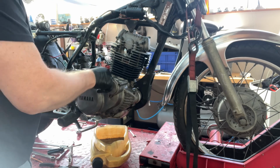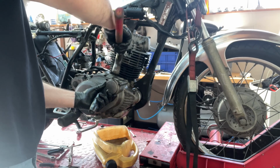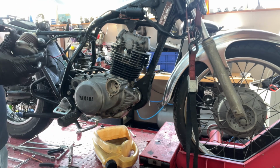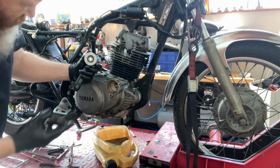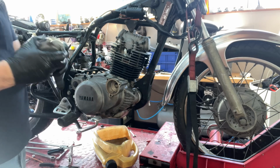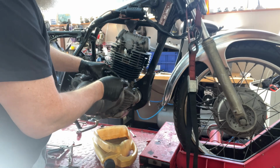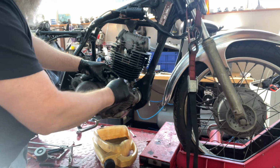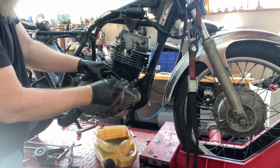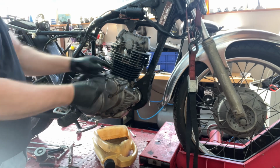Now, normally when you do a service on these things, there's a little 10mm screw on top of that little oil filter cap. You undo that, and the oil drains out as much as it can, and then you crack this off and not very much comes out of it. But in this case, because it's been sitting around for 10 years, it's completely blown dry. Everything was bone dry. There's a little drain hole in the bottom that drains it back into the case. So I just left the filter out and put a couple of screws back in, just while the rest of the engine was taken out. That's that little 10mm bolt there that allows the air to come through and lets the oil filter drain out when you're draining your oil. Then you just lightly crack it open and close it up again.